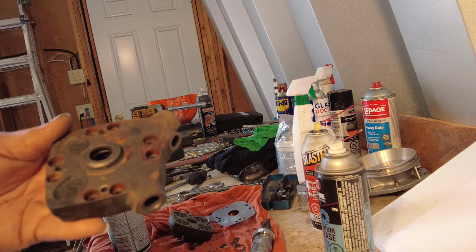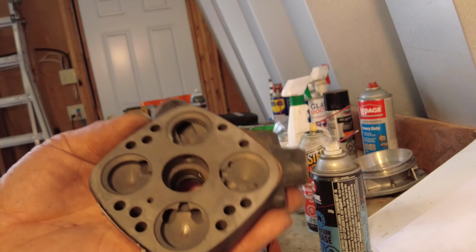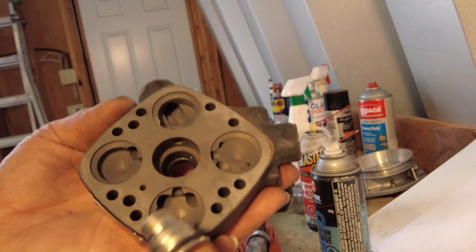Now I have to put these things in here and put O-rings around those, eh? So I'll go over to the vise and slide it together. So this part here goes in like this, and then it slides in until the threads come out. So I'll put what do you call it? I'll put a socket over this end and push on it with the vise at that end, and put some oil on it so it goes in easy, right? I'll just use this multi-duty lubricant.